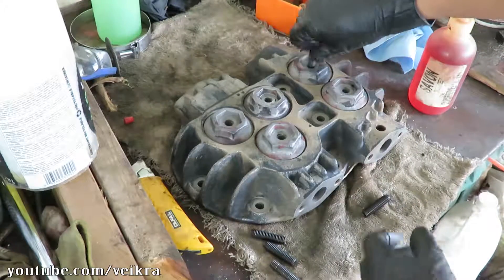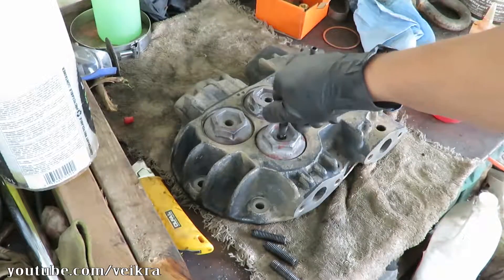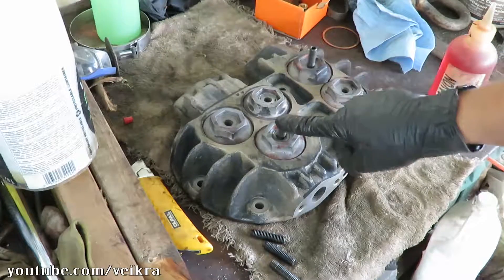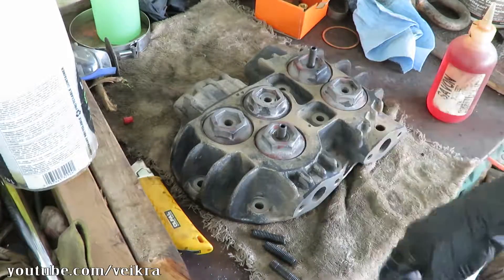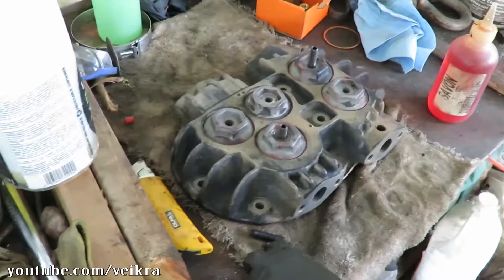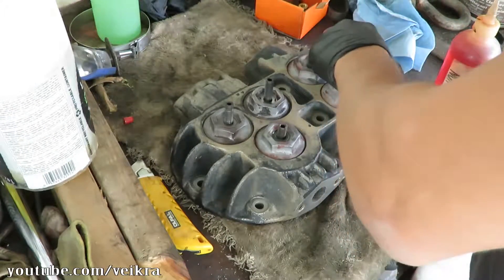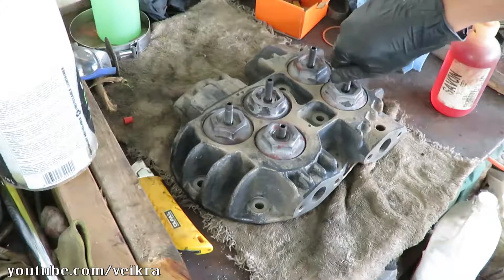This one here gets a new one. I'll put them loosely on so they don't move inside the head, then I'm going to put the head back on and back these off and tighten the caps — because you need to tighten the caps first. If you tighten this down and then tighten the cap, it's going to be way too tight and it will never come out or you'll break the stem. We'll have the caps there afterwards, but not yet — I'm going to tighten everything down.